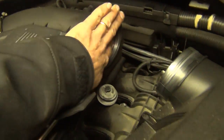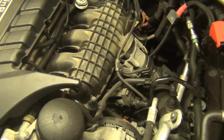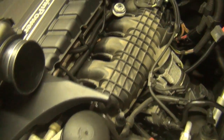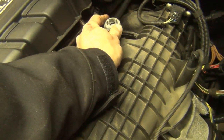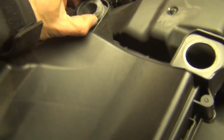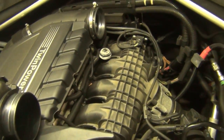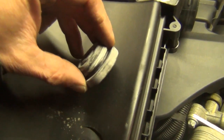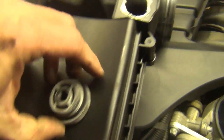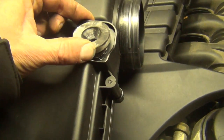Make sure your gasket stays on and take that out of the way. Looks like one of my rubber holders for the air box stayed, so I'll pop that off and reinstall it in the air box. It just has a slot locator — put a little bit of lube on there and just have to work it back down into the slot.